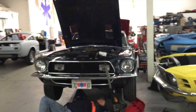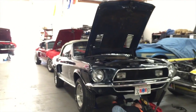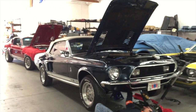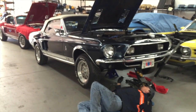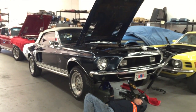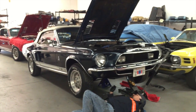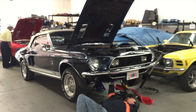That's exactly what happened here, so take notes — we all learn together. If you've got a 68 and you've got headers on her, you're gonna need a Boss 302 setup line. It's a dual line system to run the power steering, or you will split your 68 power steering line. Please make a note and you won't have to go through what we're going through over here at Mustang Valley. Remember, we take the frustration out of restoration — you watch us get frustrated, you guys relax.